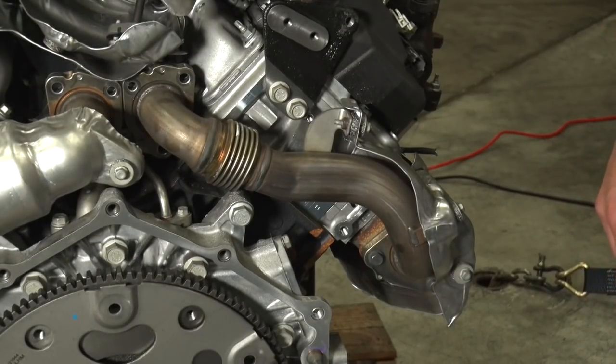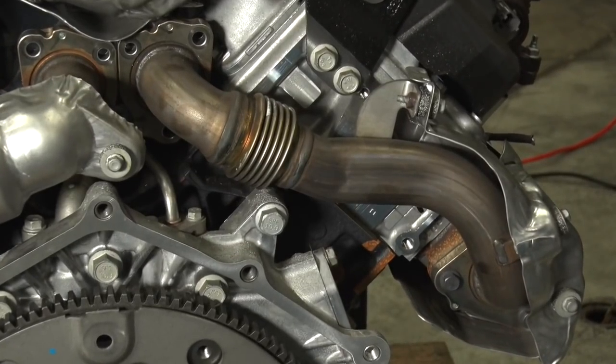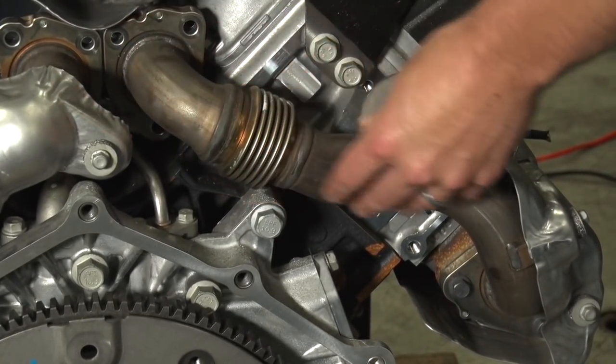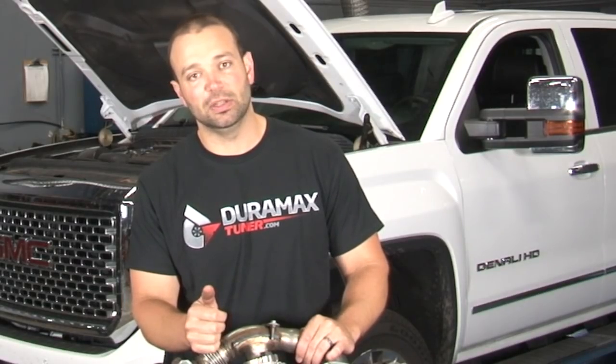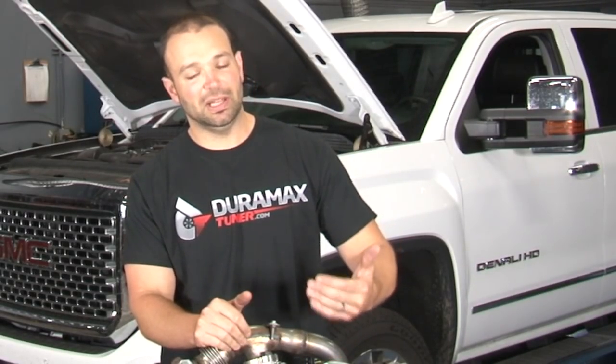It's important to talk about the uppipes. They are a little bit smaller, and that's one of the other themes we're seeing on this engine — on the exhaust side, things are tight. The pipes are smaller, the turbocharger on the turbine side is relatively small, and there's protection in the ECU around temperatures on the turbine. GM is definitely cautious on the temperature on the turbine side, and I think that's kind of where the weak link is.